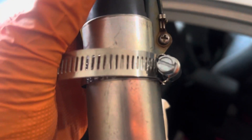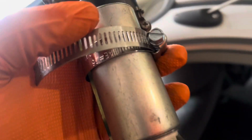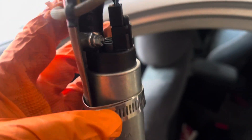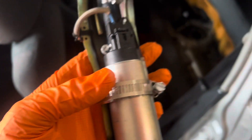The only thing I did was put a metal clamp on here instead of a zip tie, because I plan on running E85. Main purpose is because it's safer for the motor — less detonation, and a little bit more power — but mostly because it's safer. So now we're about to go ahead and drop it in the tank.